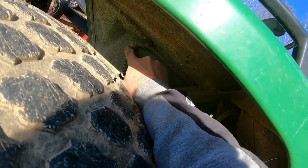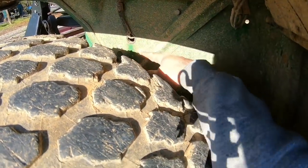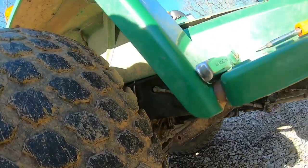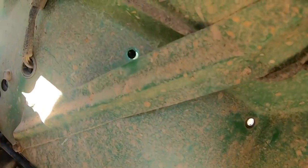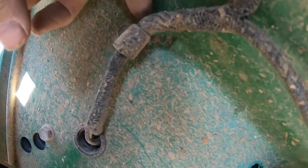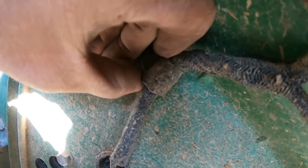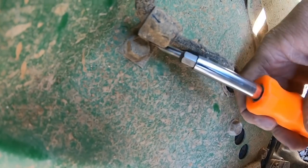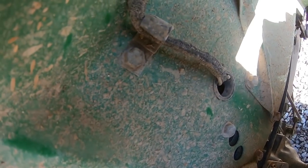There's a bolt there and there, and there's a couple right down in there, and then there's this nut right here. See if we can pull that whole fender off there. So they are half inch. That one's already out. This one's got a little wire harness bracket on it. Let me take something to bend it out of the way without getting into that wire too bad.